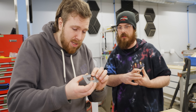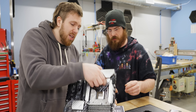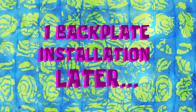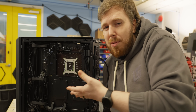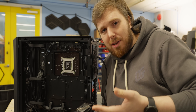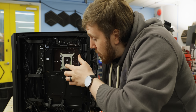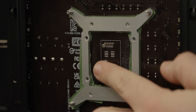There's a small thin insulation layer on the backplate, probably to make sure that none of the traces or contacts are bridged — and there are definitely open vias there. So we plainly won't be able to get the same degree of contact on the back as on the front. We're on the wrong side, and this is not a flat surface like the cold plate on your cooler or the IHS on your CPU. There are tiny electrical components that will prevent the cold plate from sitting flush with the back of the motherboard.